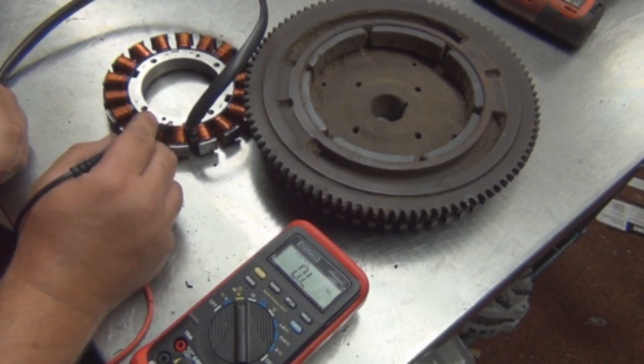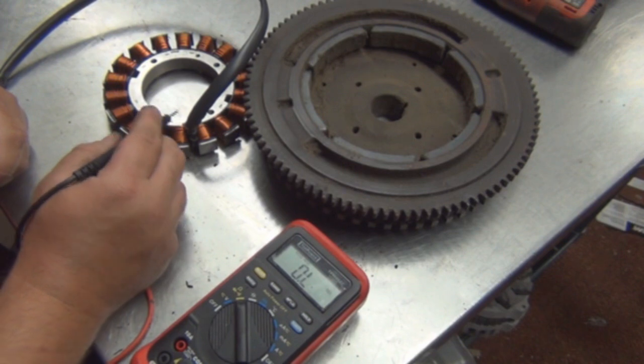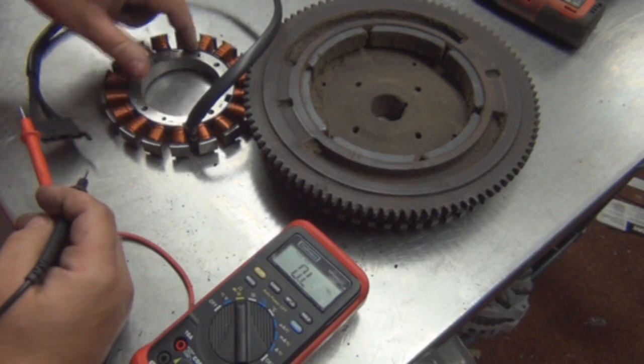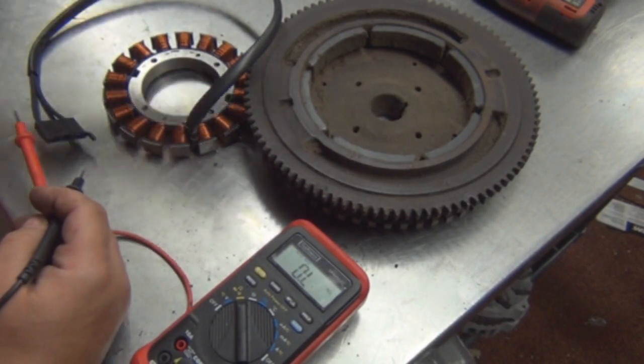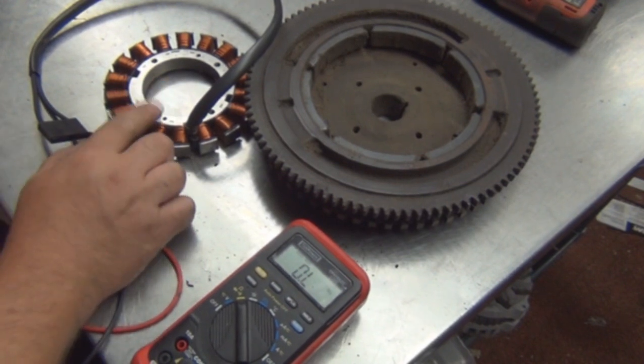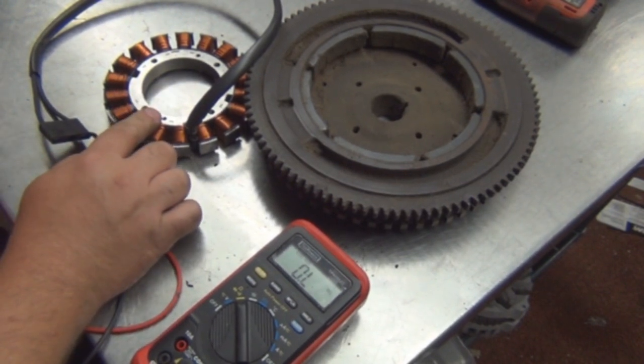And that's what happened on the old mower. The cooling fins got dirty and it overheated, melted the whole thing, shorted out the stator, and fried the rectifier. So when these go bad, it'll cause a mess of trouble.